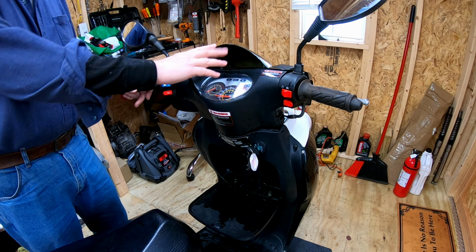Okay, what I did was I took the nut off, and then I threaded it back on about halfway so that the nut was out further than this. I took this piece of metal, ran a screw in here, did it this way, ran a screw in here, and I ran a screw in here into these two holes and tightened it up tight. And then I took a hammer and smacked the center of this with the tension on this, and that popped the rotor out. So let's get this in and get this tight.